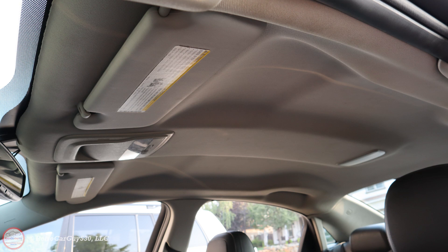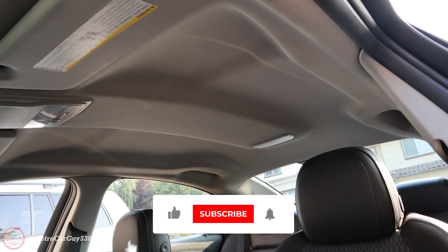One other quick tip: when you put the weather stripping back in the door frames it may catch the edge of the headliner and look off. Use a plastic trim tool to push the headliner out just a little bit to let the weather stripping go back into its normal installation position and it'll look much better. After all that work, things worked out quite well — the headliner isn't in perfect condition but it's far better than the one I had in there before.